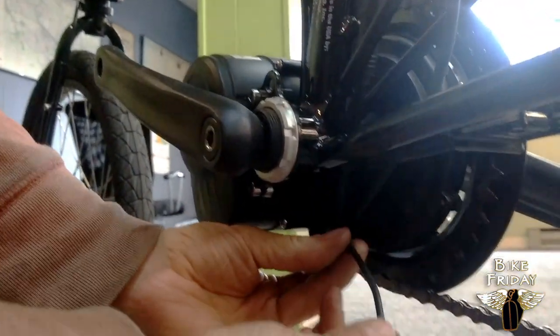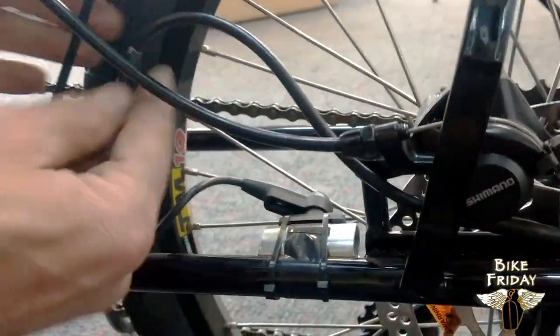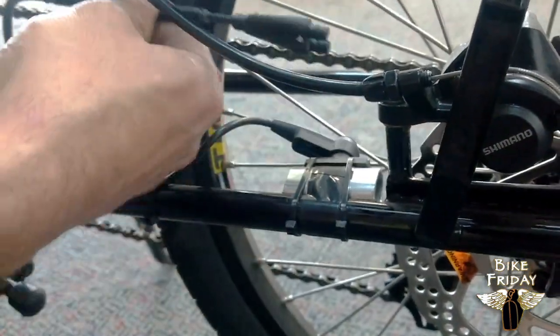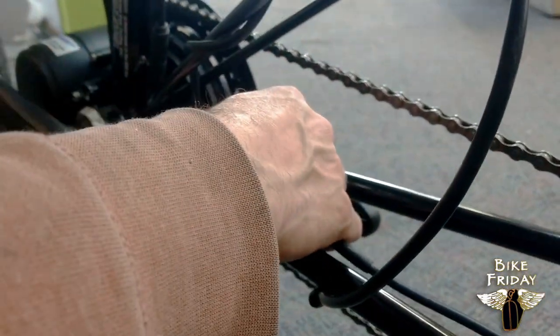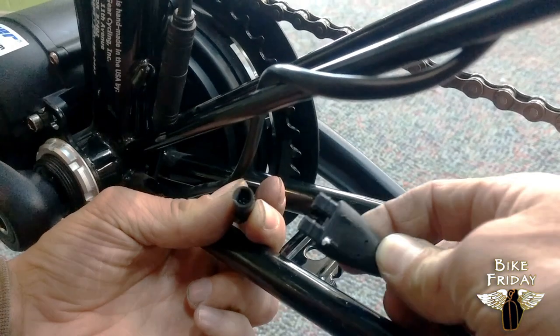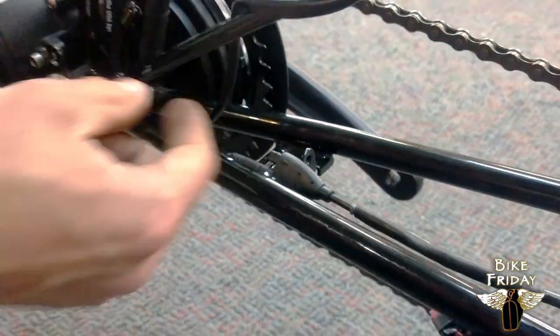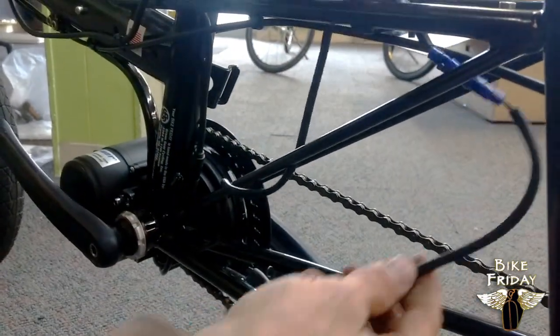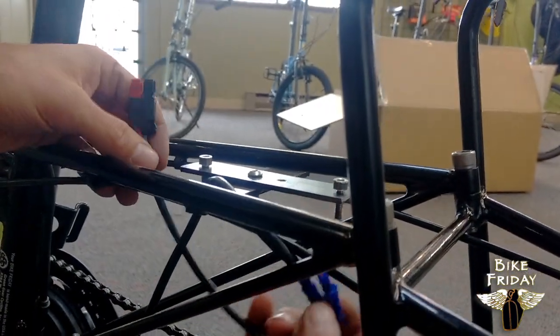The next cable is a small one, and we're going to keep it through the frame. It needs to be connected to the speedometer pickup — I'm reaching back to the back of the frame by the rear wheel. Here's the speedometer pickup; that cable's been tucked out of the way and we need to reconnect it. There's a white dot on this one, and it's a D-shape to push those pieces fully together. The third final cable is the power cable to the battery. There are a couple sets of connectors just to get us a long enough run to the battery.